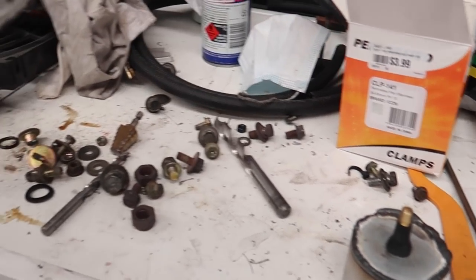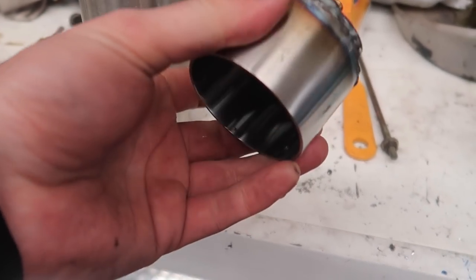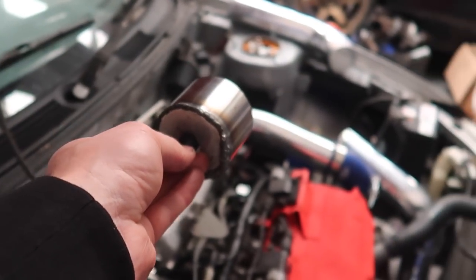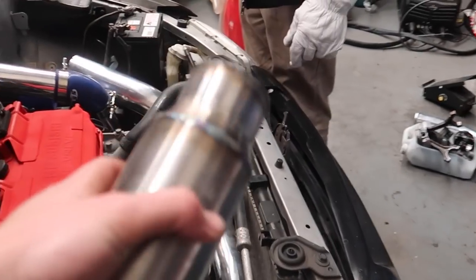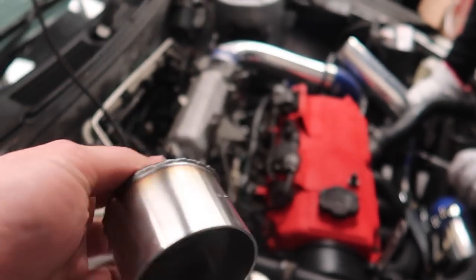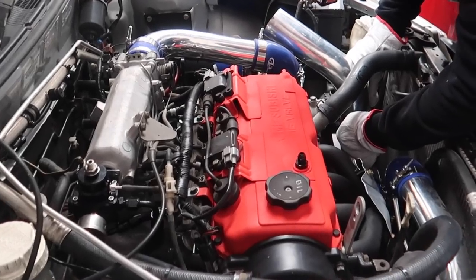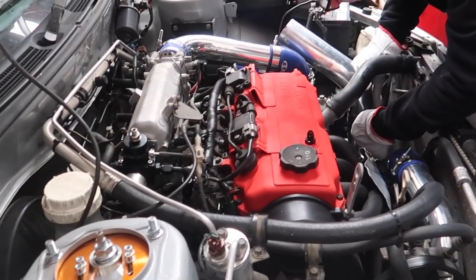So what this is is simply a two-and-a-half inch pipe blocked off with a bike valve. You put that on this side of the intercooler piping, and then this end which is blocked off goes on the front of the turbo, and then we pressurize the system to see if we can hear or see any leaks. Very simple, cheap setup — thanks Dr Drift for the idea. We'll bolt these up and see if we've got any leaks on our clamps.